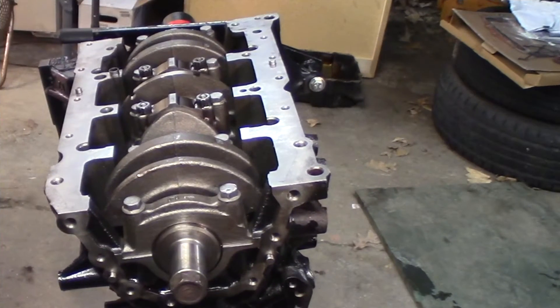We're going to get the balance shaft assembly torqued down to the motor. It's got all these different sized bolts — they all had different torque specifications, they all had different angles that they had to be turned after they were torqued, there was a torque sequence, so you had to change fasteners and torque wrenches within the torque sequence. It was really crazy but we got it done before the Loctite set up.